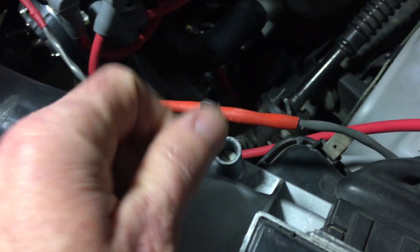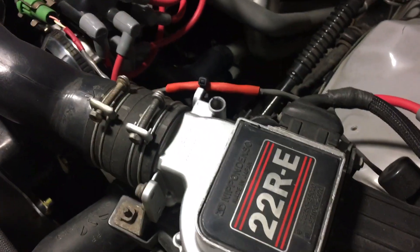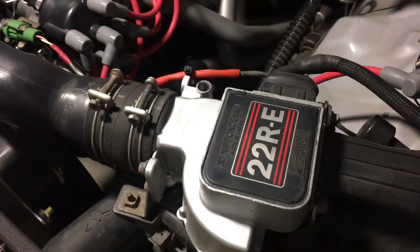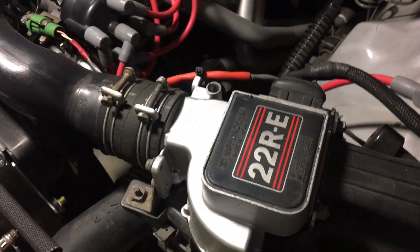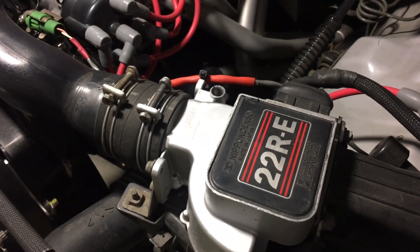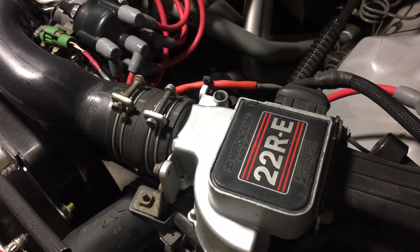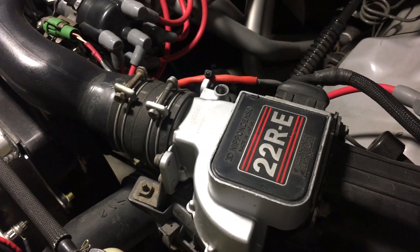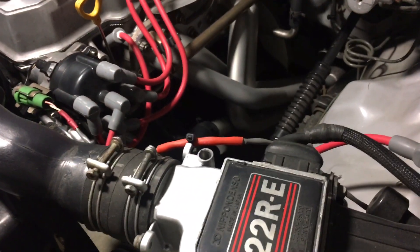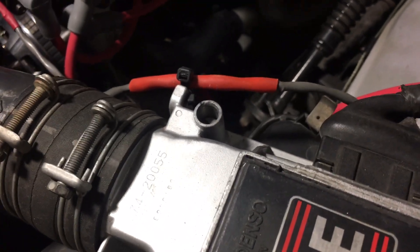So if you've been screwing around with this and you don't know where you're at and you can't figure out what the right amount of turns should be — it's very difficult because once you get out of the original setting, or you start making a lot of adjustments and don't fully understand what this was, it can be really hard to get back by trying to observe how the truck runs. The reason for that is the computer, the ECU, is constantly making on-the-fly adjustments to get the air-fuel ratio. You've kind of thrown it into nowhere land, but it's always trying to get back. What you can do is get back in the ballpark.